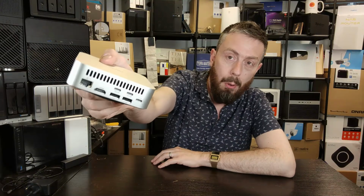That single port there on the rear, 2.5 GbE with very little means to upgrade it, not great. That 8 gig of memory, being a little unclear about the architecture, and the fact you can't even upgrade it beyond 8 gig, despite the N100 supporting substantially more memory, is disappointing. And the PCIe slots there and the overall performance I found internally just felt lackluster. Overall, I'd say right now the AiFFRO 4-bay SSD NAS is just very blah. I hope to see them do more with this, but they've got to move away from the aesthetic of a mini PC because it's trapping them in.